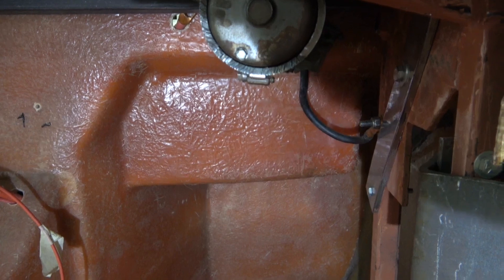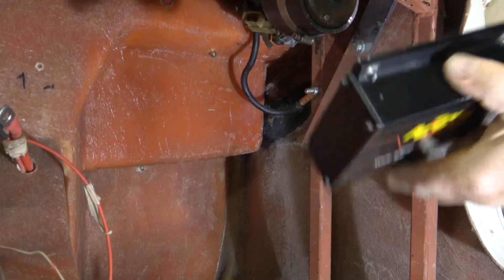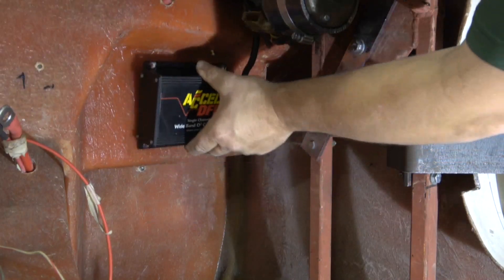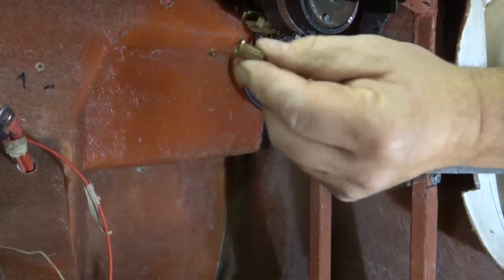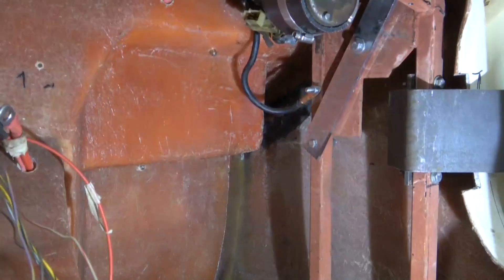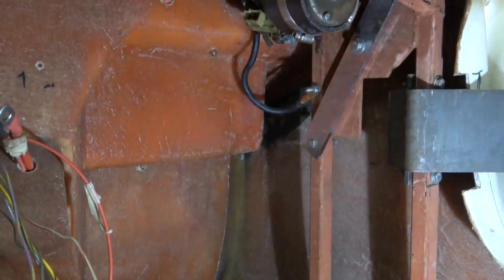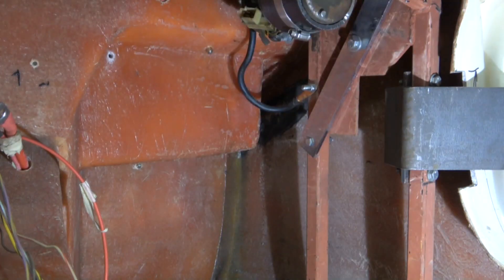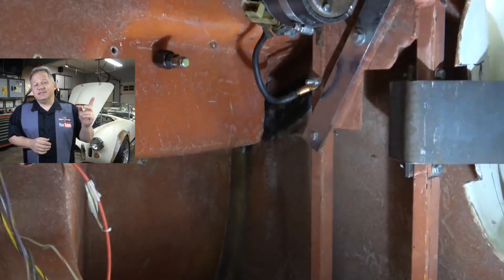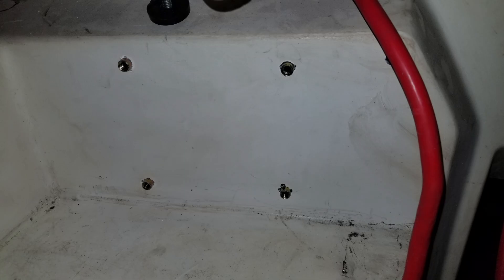It will be out of the way, and since that is where the battery box is, the fasteners on the back will not be seen — the battery will hide those nicely. We'll mount this up in this little recess here, right around here somewhere, using four rivet nuts — quarter-twenty rivet nuts. I did put one hole in the wrong spot; you can see it when the battery is installed, so I had to move it over so that all of the holes are hidden behind the battery.